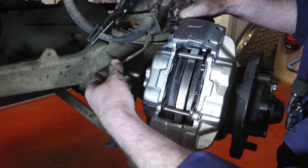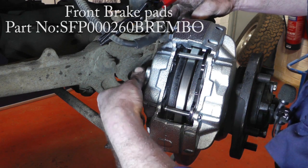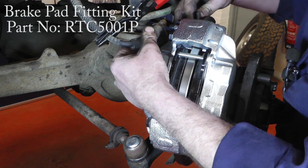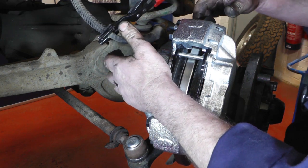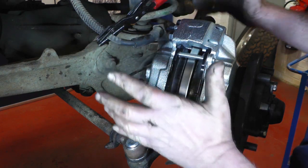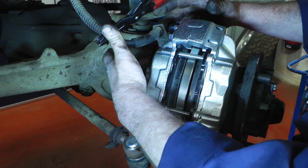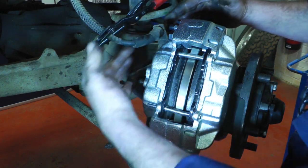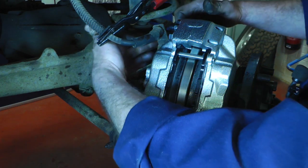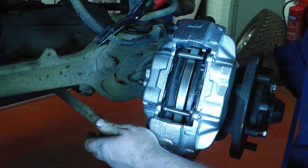Now going to replace the brake pipe - just be careful to make sure you don't cross-thread it. Get that started, then put the clamp back on the top of the flexi joint. It's worth mentioning that once the brake pipe is all on and everything's tightened up, just turn the steering from lock to lock, because the brake pipe gets really close to the bottom of the spring hanger. Just make sure it hasn't got bent in any way and isn't going to catch - or if you've replaced it with a new copper brake pipe, make sure it's not going to catch the way you've bent it.